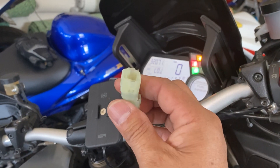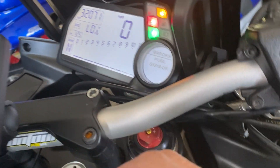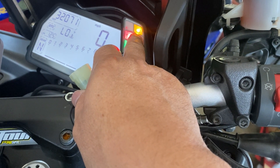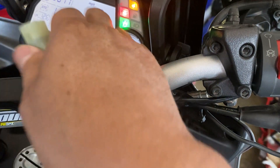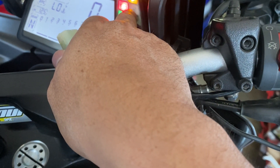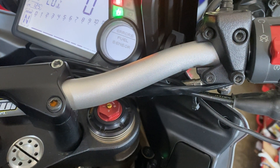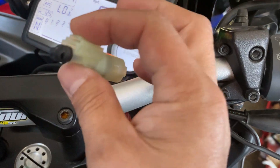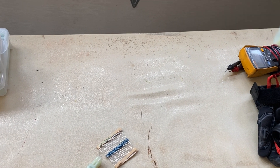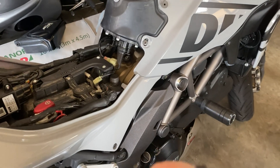This is the second version of this bypass that I have made that accomplished the goal of getting rid of the blinking light and the check engine light. The reason I made version two is that one of the replacements — the D-Spec fuel sensor, which is now on F — required a software firmware update for the ECU, which reversed the readings on the fuel sensor.